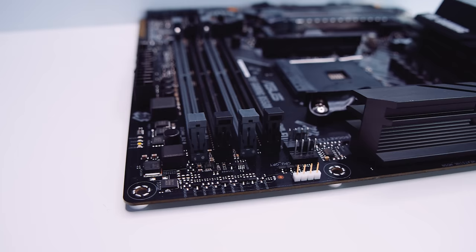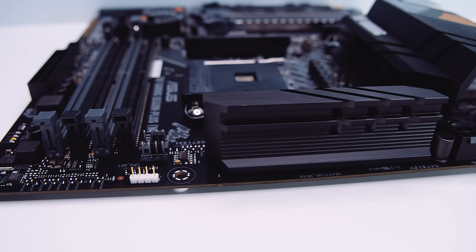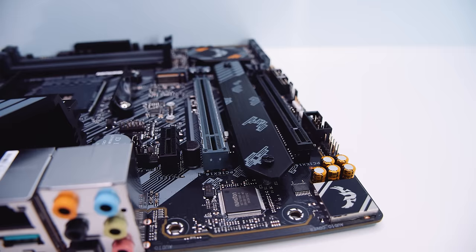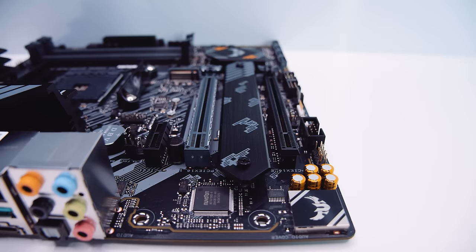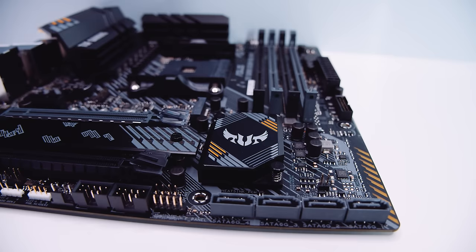On the top side of the board there's another RGB header — a 12-volt RGB header — two PWM fan connectors, one for an AIO pump and the other for the CPU fan. There's a big heatsink to help cool that 8-plus-2-phase digital VRM setup, which we'll talk about a little bit later, and an 8-pin EPS power connector for your CPU. For PCIe slots, there's a x1 slot at the top, a x16 slot for PCIe Gen 4, and another x4 slot that's actually a x16 size. There's also an additional PWM fan connector. Because this is a B550 board it does not require active cooling — it's passively cooled — and what we're looking at here is the chipset heatsink with the big TUF logo on it.